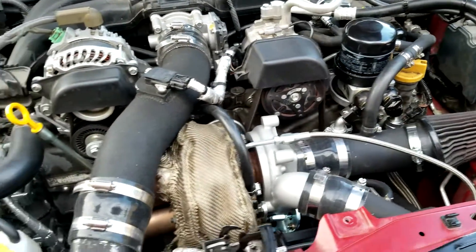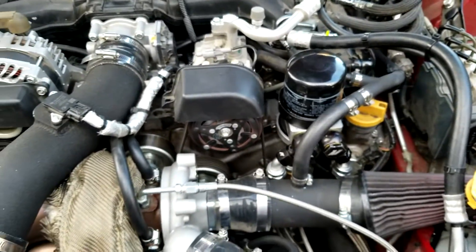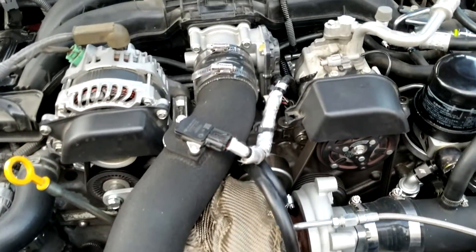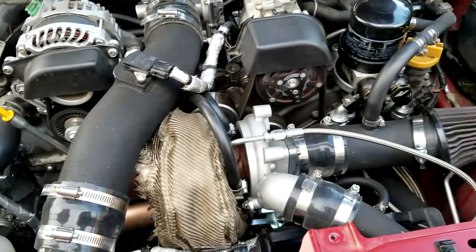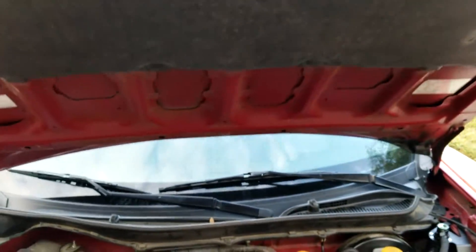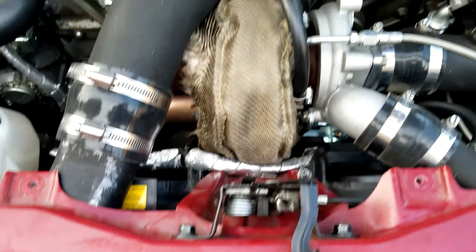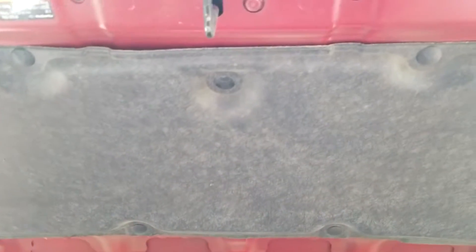In a turbo car, temperature is very important. The cooler your intake air temperatures are, the better boost you'll build and the more power the car will have. You can help by adding a hood vent, ceramic coating the hot side, and don't forget your turbo blanket — without it the turbo will start burning surrounding lines, wires, and even your hood paint.